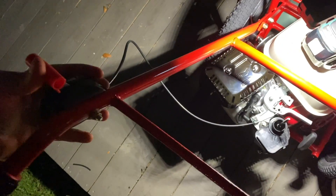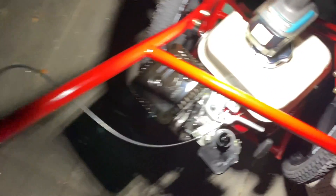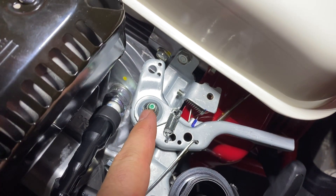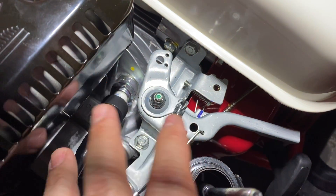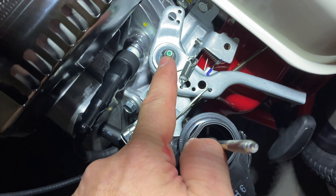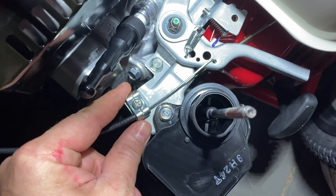Give me the overview just like that. You can also adjust how stiff you want the throttle to feel by tightening and loosening this master nut right here. You shouldn't have to take any of this stuff apart when installing your throttle cable — just some adjustments. You're going to be adjusting this, which is a 10 millimeter bolt, and then you're going to be adjusting this, which is just a Phillips head.